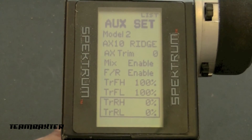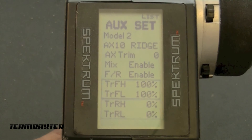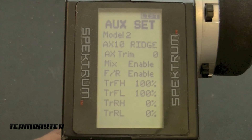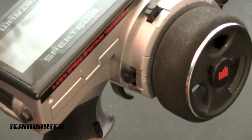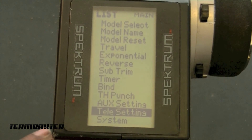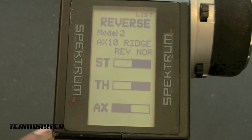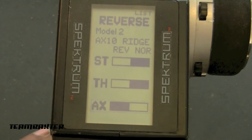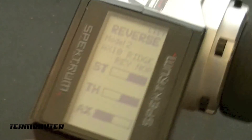So you want crab steering. Since the radio doesn't have a three-position switch, this you have to toggle manually. Your two-position switch is already configured to turn dual steering on and off. So by changing the auxiliary reverse, this just affects the way your servo reacts to your input. Now you get crab steering when you reverse the auxiliary channel.